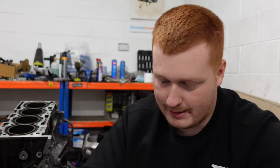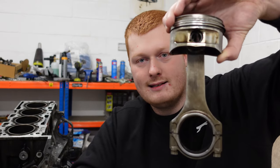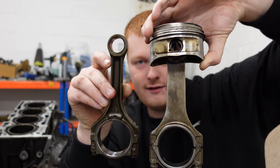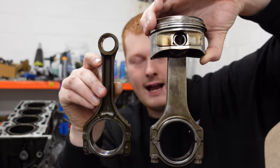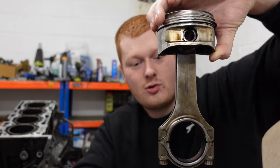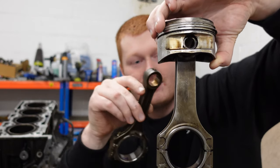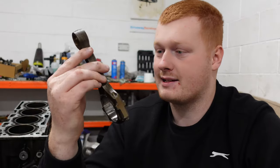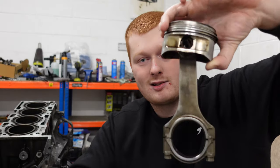Some people have made a lot more, but generally 400 foot-pounds is the safe limit. Now if we compare that to a Cosworth forged con rod — this is an Evo 10 Cosworth forged con rod — we can see a completely different design. It's literally twice the thickness, and not only is it twice the thickness, it's actually a lighter con rod. It's got stronger bolts and the metal is forged. Forged metal is a lot stronger than cast metal, and that really illustrates why they are so much stronger.